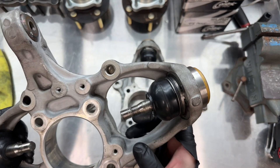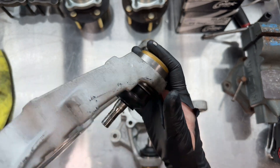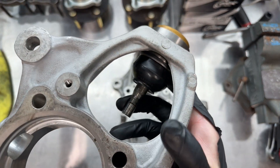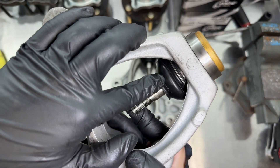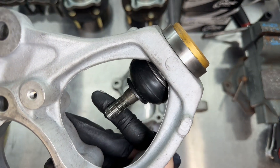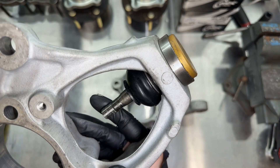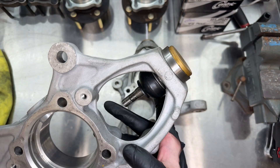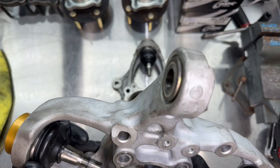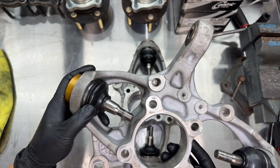Here's a quick look at the Carbon 6 ball joints. I took these off earlier in the week because I was replacing the poly boots with OEM rubber boots. The way this ball joint sits and the boot is creasing right here on this section is a little bit worrisome — it's only been on for about three days and one drive and it's already put a nice little crease in the rubber. Hopefully that holds up and doesn't become a point of failure. That was my whole point of replacing the boots — I thought OEM rubber would be more durable since poly ball joint boots don't hold up that well in my experience.